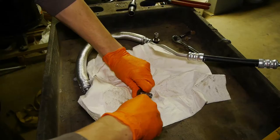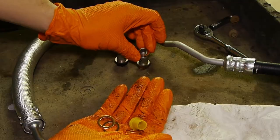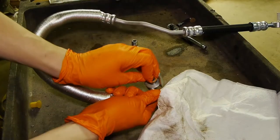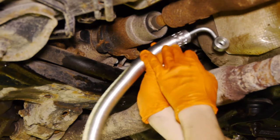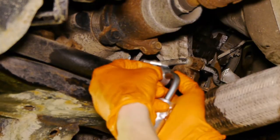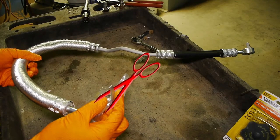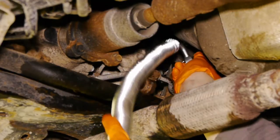Since none is stuck to the pump or the rack, take that old washer off the bolt — maybe use a screwdriver — and put one new washer on each bolt. The other washer will then go on the other side of the hose fitting. Remember, the side with the long tab or with the heat shield goes in first, and the tab is supposed to face down. I actually had to cut half of the tab off because it was in the wrong spot. After I cut half of it off, it worked fine. So check your hose before you install it.